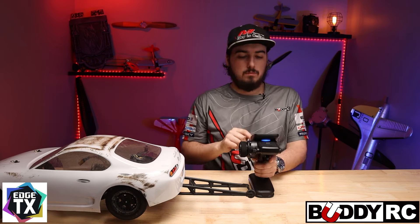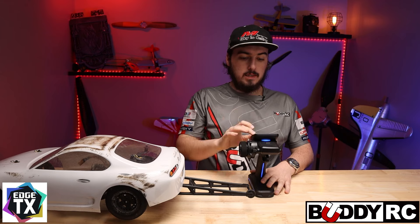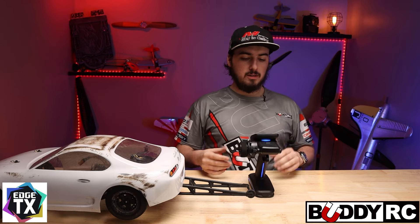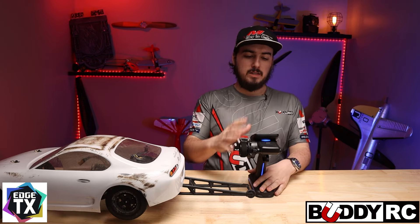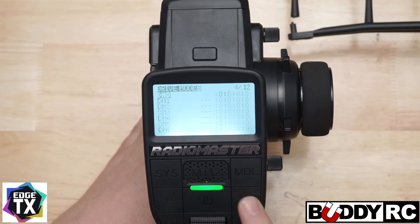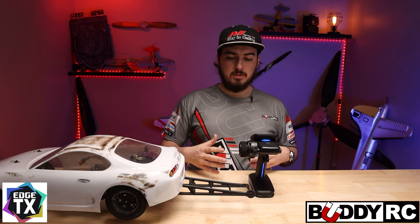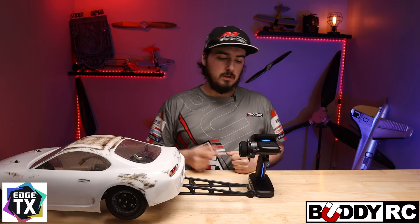Okay, so we're back from running the car outside and kind of showing you the capabilities of the MT-12 and a drag car. I'm going to run through the actual setup here and then I'll kind of show you how it works. As far as the actual setup for this, it's fairly simple. The biggest thing you need to do is go over to your mixes — this is where you're going to get the actual mixes of the radio. This is what you're going to do for your actual throttle, so you can slow your throttle down when you're giving it throttle and also be able to select a curve.